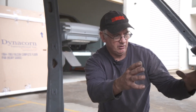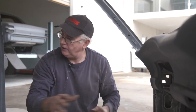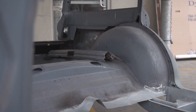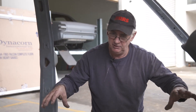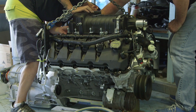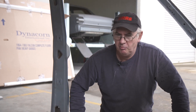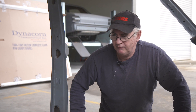The chassis primarily carries its weight and suspension load in the bulkhead — that's the main structure at the front — and then at the rear, the main weight is in the rear rails where the suspension and driving forces come from. The bit in between is where you get a series of twisting and beaming aspects. The things that cause this are high-powered engines, inadequate gauge of steel, and badly done repairs from accidents or rust — all sorts of reasons why a car becomes really floppy.